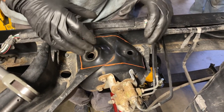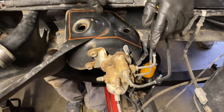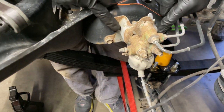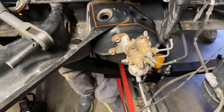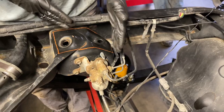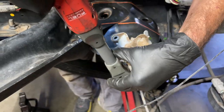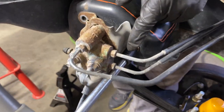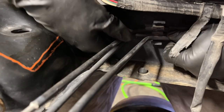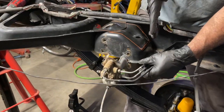The next thing we're gonna do is we have to cut out a section of metal here to be able to fit the new cross member in, and one of the shocks is gonna be riding right here. We're a little bit worried about hitting these brake lines when we're cutting, so we're gonna disconnect this bracket right here and then hopefully be able to pull the brake lines a little bit further away so we're less likely to cut into them when we're cutting on this side. This is held on with 3 12-millimeter bolts, and I'm gonna zip them out with a Milwaukee ratchet. I needed to switch to a short socket right here. They're captured in a clip right here. I'm gonna see if I can pull them out. That gives us a lot more room to cut.